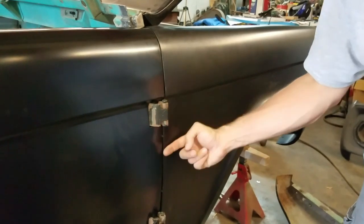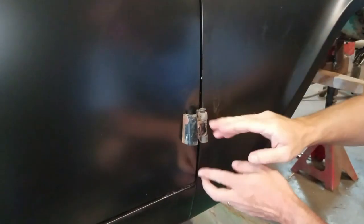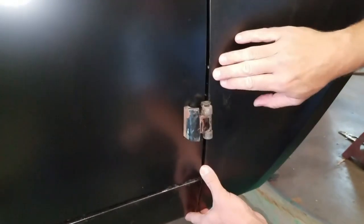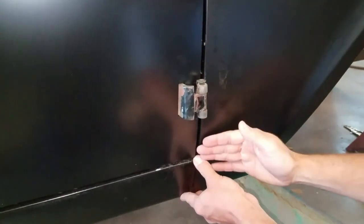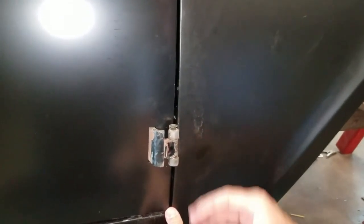There's the door gap. This door is actually fitting pretty good. It breaks a little wide right in here — the gap is real good from here to about midway, then it gets good again back down to the bottom, but right in that middle section the door seam widens up a little more than I really like. I can feel in the radius that something's just not quite right there. So I'll probably end up cutting this and moving it over just a little bit. I know it's a lot of work just to make that gap straight, but it's a little too wide — that'll give me heartburn right there.